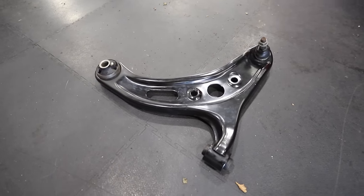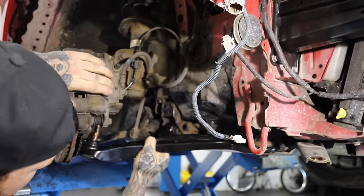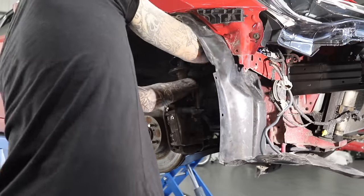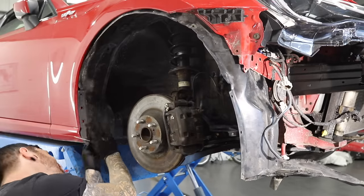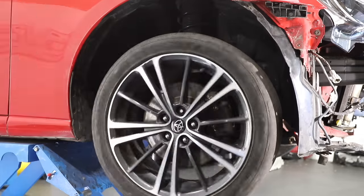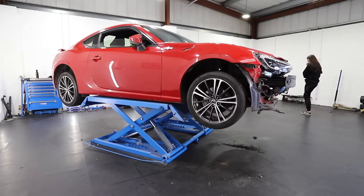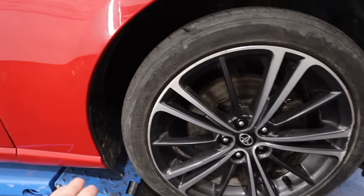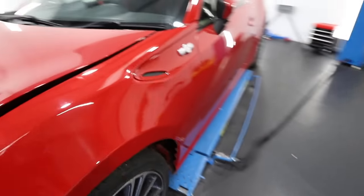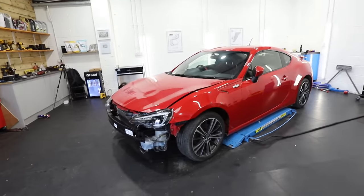I've managed to pick up a driver's side wishbone. A bit of copper grease on the ball joint and it's ready to be fitted to the car — same process as before but in reverse, without the angle grinding this time. Then the arch lining I found in the boot goes back in, and the front wheel goes back on, which turned out to be pretty buckled. Then it's the moment of truth — is the wheel sitting in the right position now? It seems to have done the job. With the trusty fist measurement, can't really get a fist in there. On the other side, we're absolutely bang on. We'll find out for certain when we get it on a tracking rig, but so far so good.